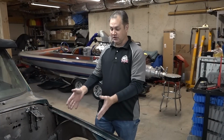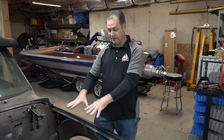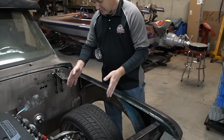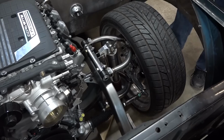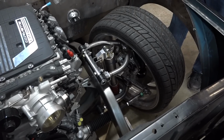We've lifted the truck and we've put a block of wood under the lower A-arm, and now we've let the truck and the weight go back down to compress the suspension. Now, as you can see here, as we look over and we turn the wheel lock to lock, we can essentially simulate what's going to happen when this truck goes into a hard corner under load to make sure that our tire doesn't hit, rub, or touch anything.